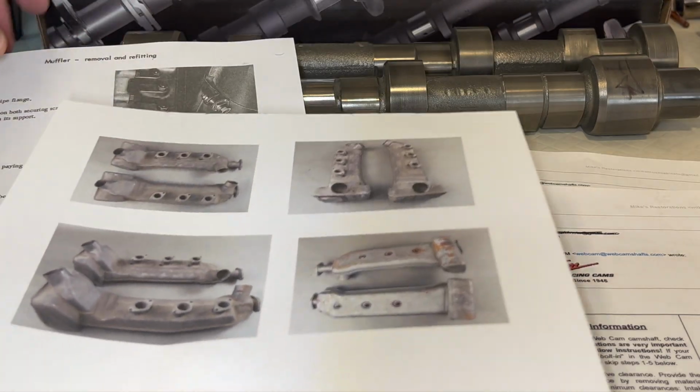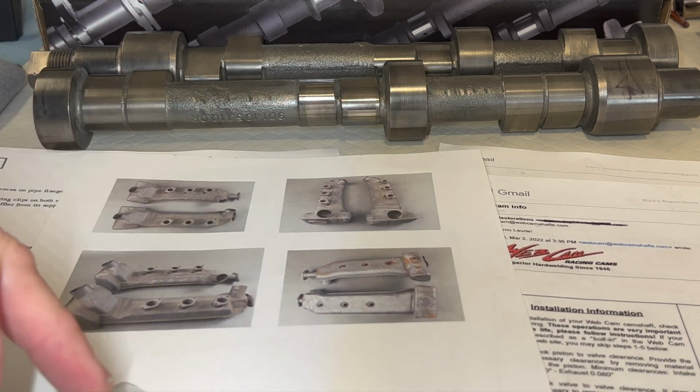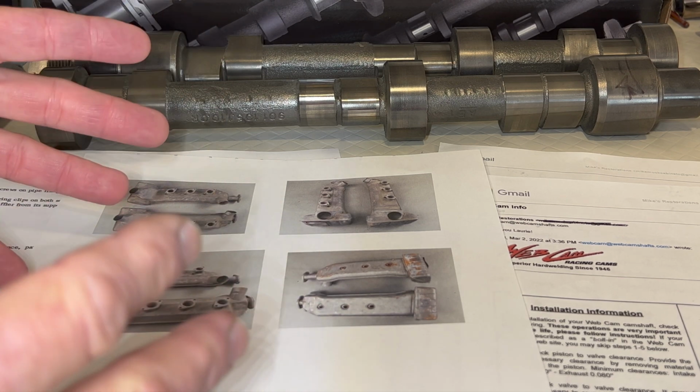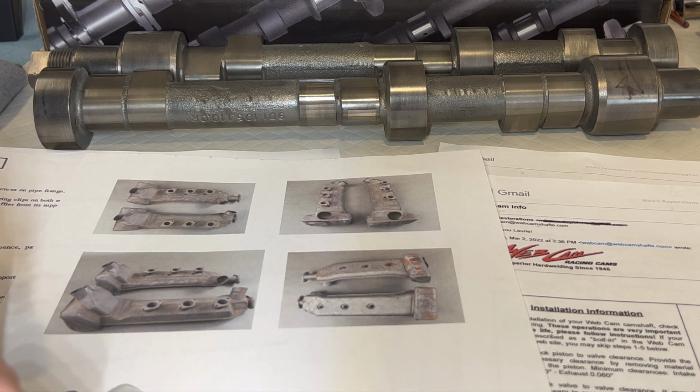That combination, with the early style camshaft, produced about 140 horsepower. So you had a horsepower bump with the camshaft and this exhaust, and apparently Porsche didn't like that, so they decided to regrind the cams, dumb them down, so to speak, and bring it back to within the 130 horsepower rating, so that it's not really competing with the S.